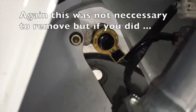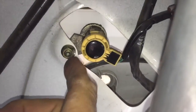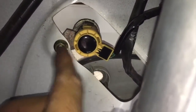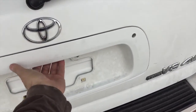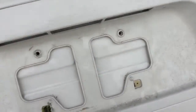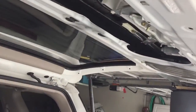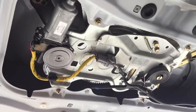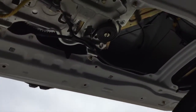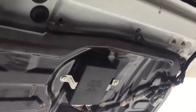Make sure you get that 1 screw set back in here to secure this locking mechanism. You work from the outside and the inside both to get that in there. It's always a good idea to test it. Make sure it's going to unlatch for you before you reassemble the inside panels. The housing for the rear window mounts are in place. You're ready to re-secure the overall panel with just a few set screws.